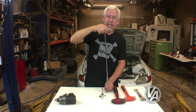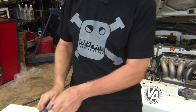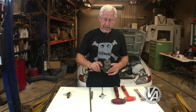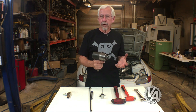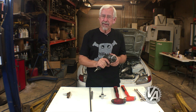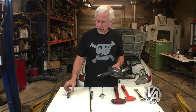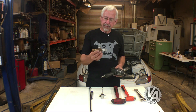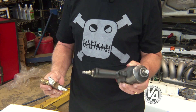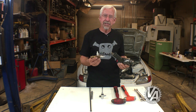This last tip is kind of an odd one. I've run into situations like taking a crank pulley bolt off where the impact gun just doesn't seem to have enough oomph to do it. So what we did is make up this little doodad that allows us to put two air hoses on the same tool.